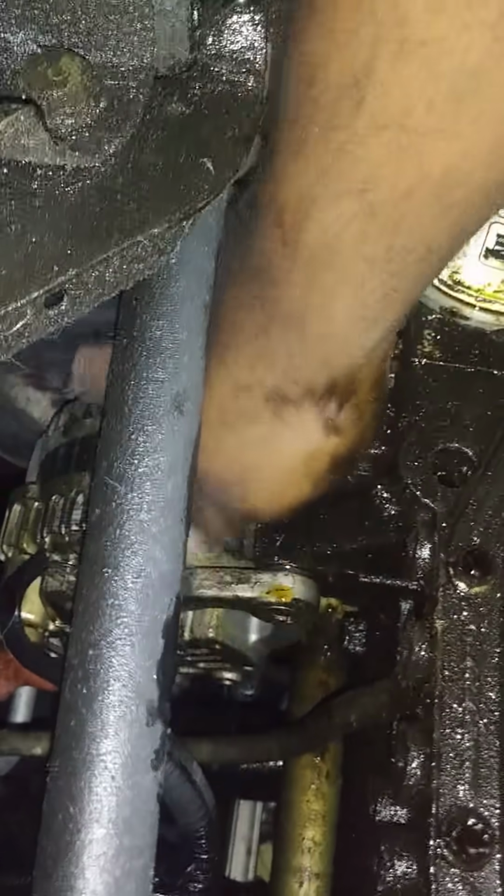Get it with my hand. Yeah, sweet. I love it when a plan comes together. Where am I at? 5 minutes and 30 seconds. I feel like I could have done better if I used my ratcheting wrench. Try to catch these bolts in. A couple of washers. Set those aside. Pull this bolt out. And in order to get this bolt out, you'll have to remove this splash guard. It's held on by two 12mm screws. Excuse me, man. I'm working with one hand.